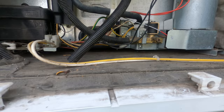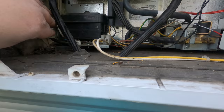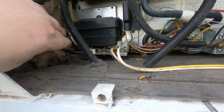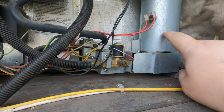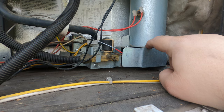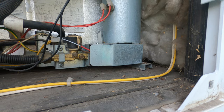We do have a little bit of leaves and some dust and dirt in here. We're going to want to blow all that stuff out so it's nice and clean. I always like to make sure that the insulation is tucked back from the electrical components, since they can get warm and you don't want paper touching anything warm. Our biggest concern is over here with the burner and the chimney. We want to make sure there's no debris in there, because mice, bugs, and insects like to make nests and love the smell of propane.